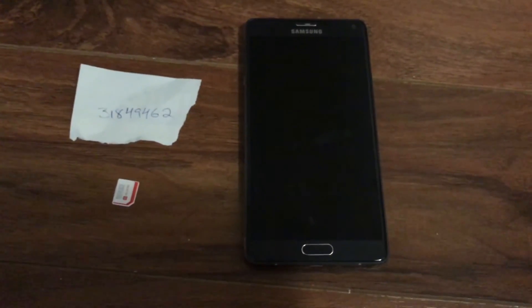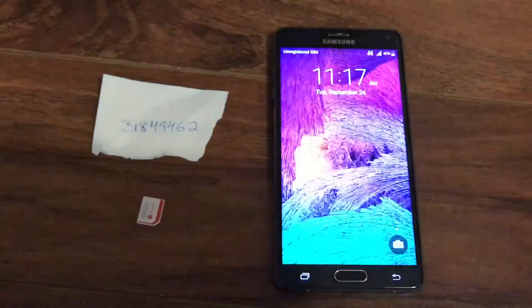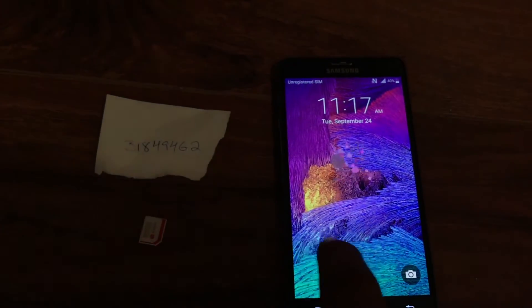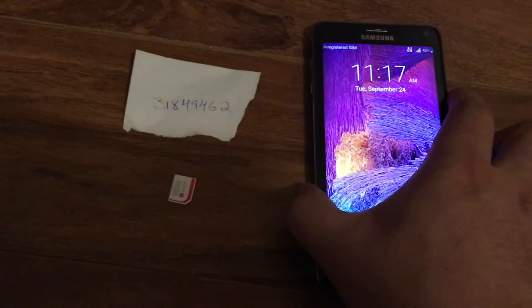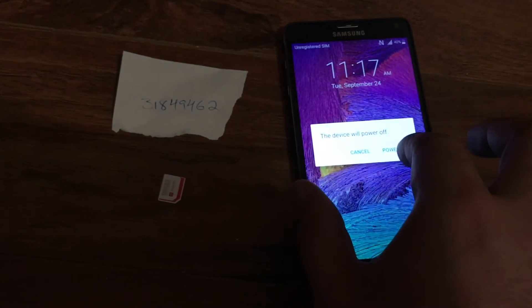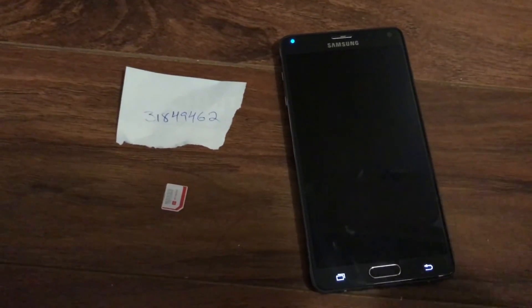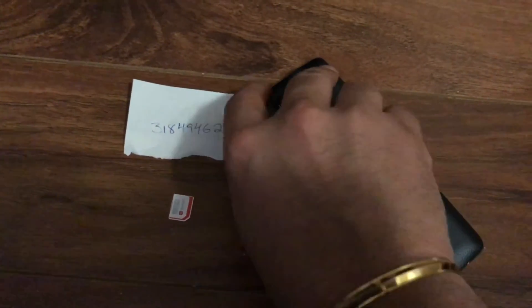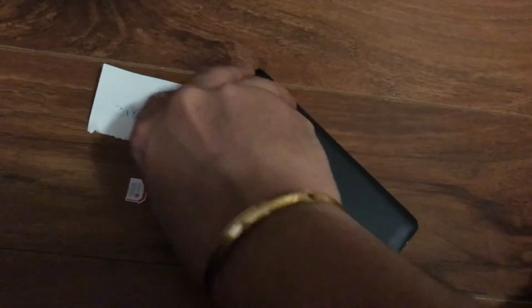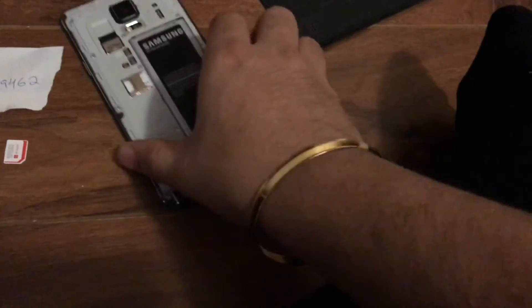Here's the quick guide: order the service with your specific IMEI number, get the unlock code, then turn on the phone and make sure all SIM cards are removed. For these older models you can simply pop the battery out or power it down. Open up the back — I'll pause for a second since I'm filming with my iPhone 6s using only one hand.